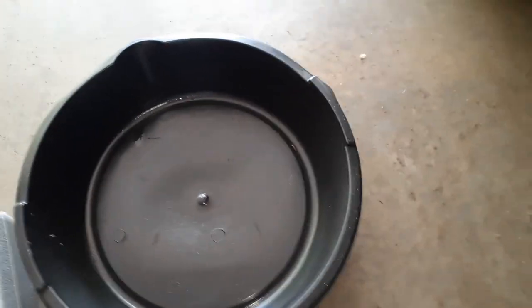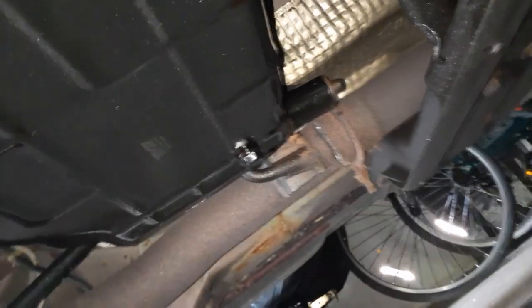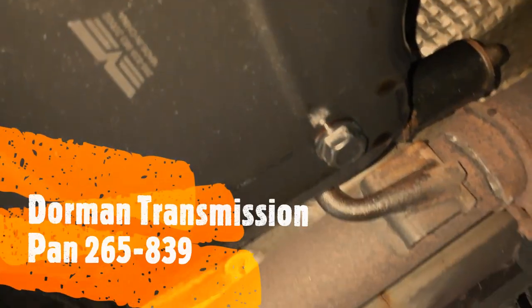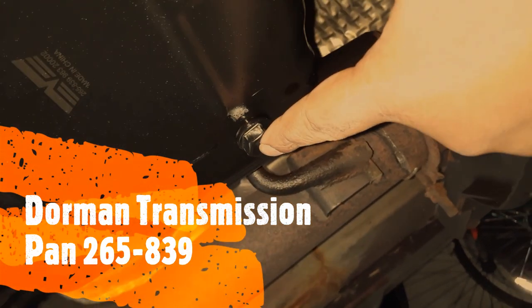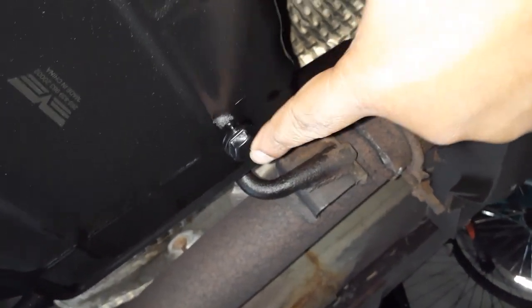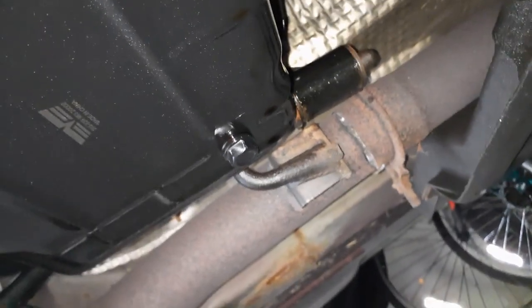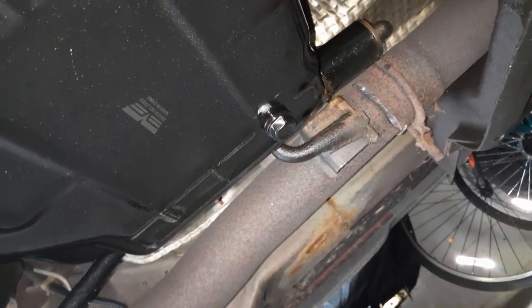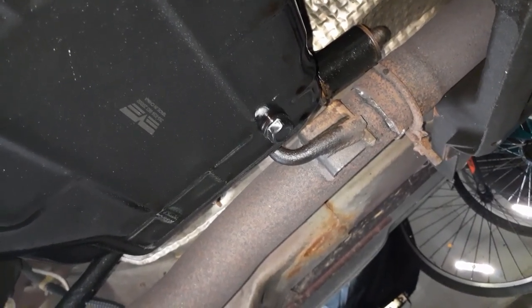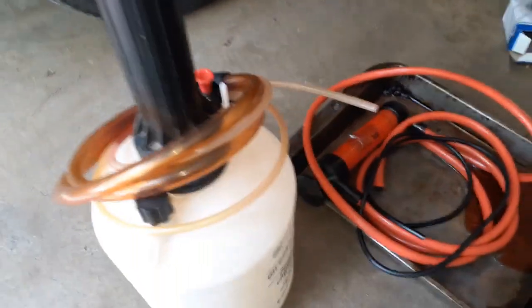What I need is a pan to collect the oil. I'm going to probably use the same oil because I changed it a couple of weeks back. The first thing is I'm going to drain the transmission fluid from the drain pan. I have replaced this drain pan — this is a Dorman drain pan, I can put the number in and you can watch my other video. This one has a 17mm bolt which will help me drain the transmission fluid. If you have the original pan from Chrysler or Jeep, it doesn't have a drain plug, so you might have to siphon out some fluid before you drop the pan, otherwise it will be a mess.